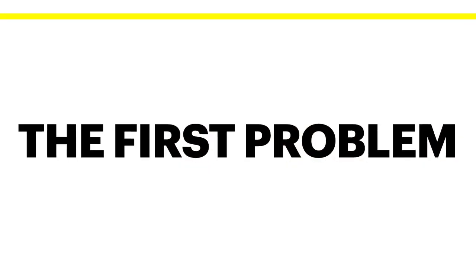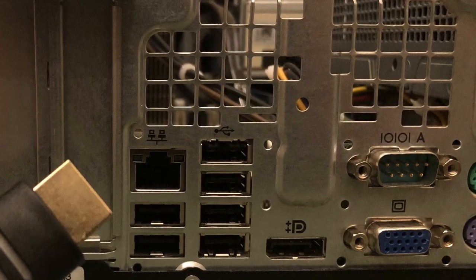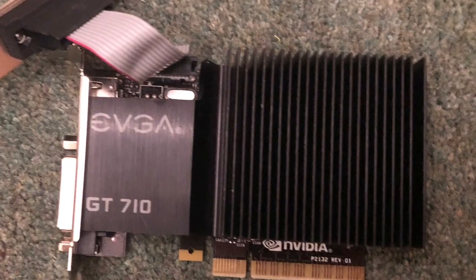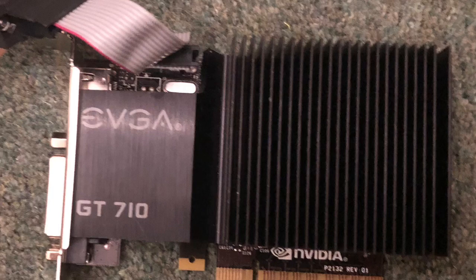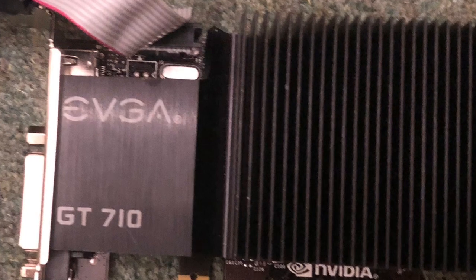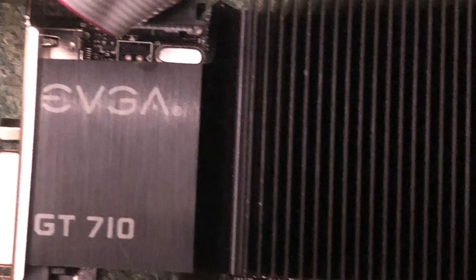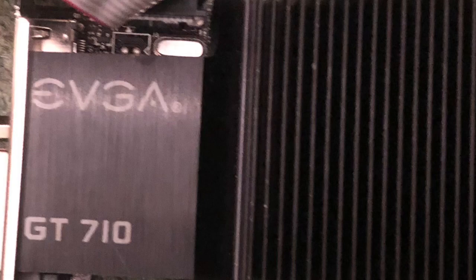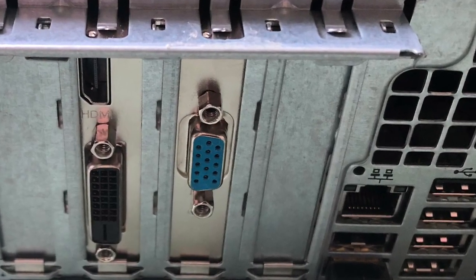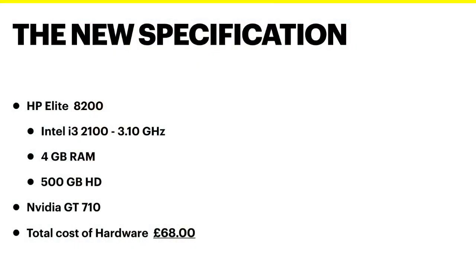At this point I had my first problem. I was dependent on an HDMI connection, and as standard the computer didn't have HDMI, so it meant I needed to add a graphics card. I was able to pick up a second-hand GT 710 for a relatively good price. Now I know it's not the fastest graphics card — in fact some people probably have their heads in their hands right now — but it gave me the opportunity to have an HDMI slot for hardly any additional cost. The graphics card was easy to fit, and I've now got a choice of connections. For a cost of under £70, I've got a device which will plug in and work.